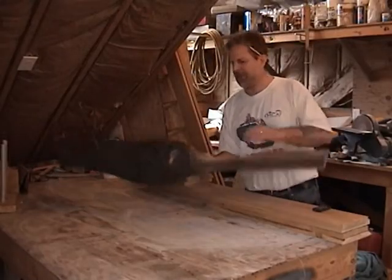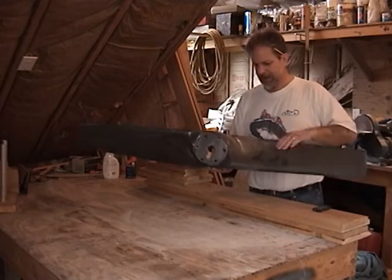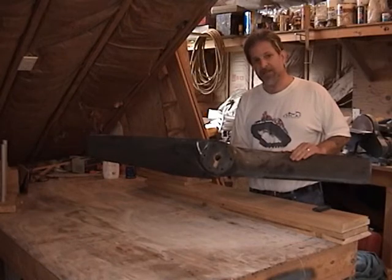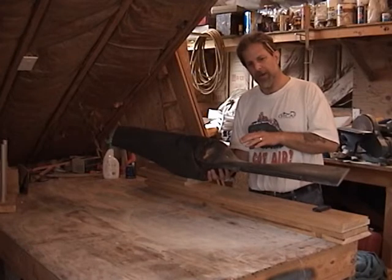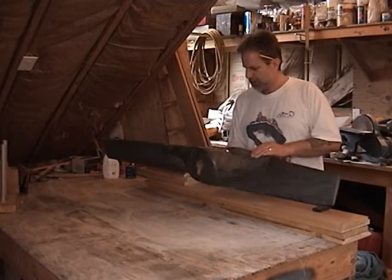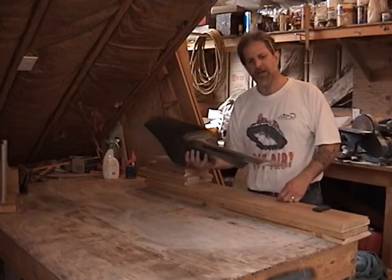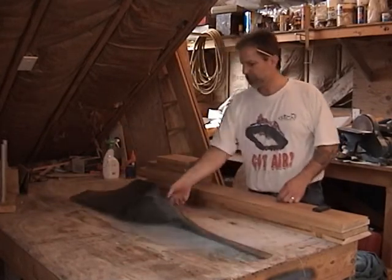My goal today is working on a prop for my thrust engine. I've got my existing F1 thrust prop — it's all carbon fiber. I used it in the 2009 racing season. It's an all carbon fiber prop with a really lightweight cedar core, weighs in about four pounds. It's 54 inches with a 60 pitch on it.